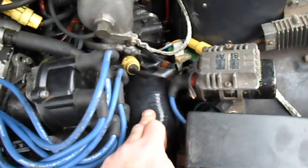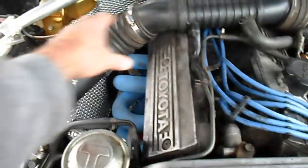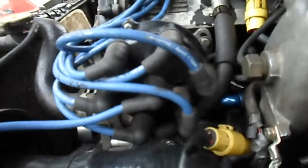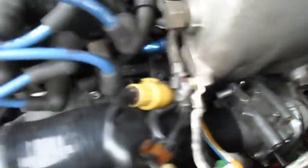This will be a two bar map sensor and it will run straight through from here. You've got the starter motor down here which you've got to be careful of. That's my idle control valve down here at the moment — it used to be under the head but I had to move it due to clearance issues with the supercharger.